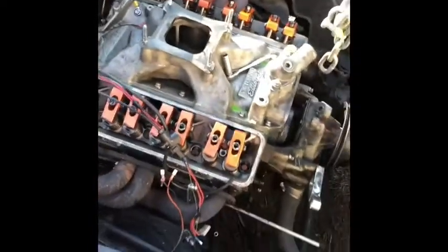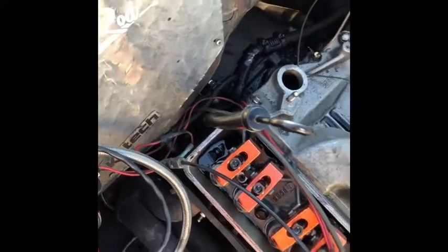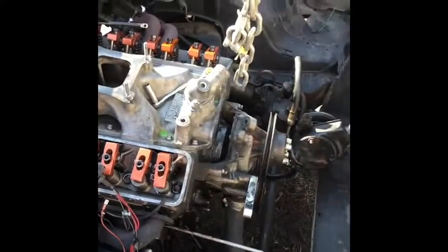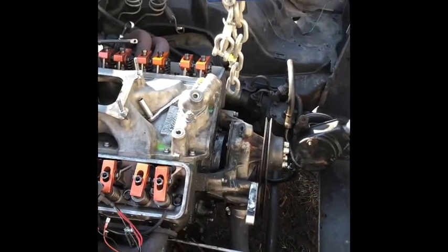We got a bolt. Then it comes out through this other side. See if I can get a picture. There we go. That other bolt right there. Yeah, that's the two bolts that hold the engine inside the car. And then, of course, the bell housing bolts. So take that out and then strap down the engine hoist and it'll be ready to come out.